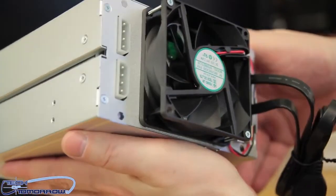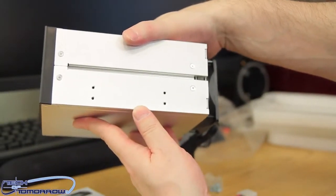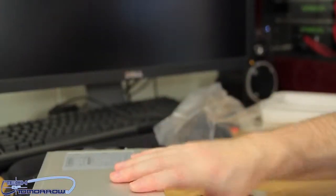This thing is like having your own backplane in your computer. A lot of motherboards have the hot swap feature. They just stick in your normal five-and-a-quarter bays and away you go. If a lot of you don't know what a backplane is — a backplane is like what a lot of servers have. You're going along and all of a sudden the drive fails. Well, in some cases you can't shut the system down. Think about a business where you can't have downtime. Hot swappable is really cool — you just take the drive out, put another one in, and it shifts the data around. This thing will also work with SATA depending on how you configure it. If you hook two of the drives up to the SATA connector, you can run them in RAID right from this box.